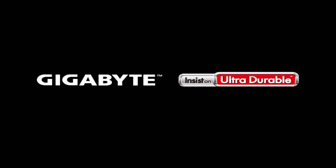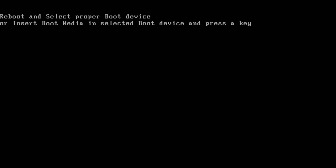Once that's done, eject the USB stick from the PC and go over to your system. In order for this to work you'll need your CPU, RAM, and GPU if required installed. A hard drive is optional unless you're installing Windows right after. You'll also need at least a keyboard, a monitor, and of course the USB stick. Power it on and as soon as you see the manufacturer logo, start mashing the Delete key. If you miss it, you'll get a 'reboot and select proper boot device' message — just reset with Ctrl+Alt+Delete or the case reset button.